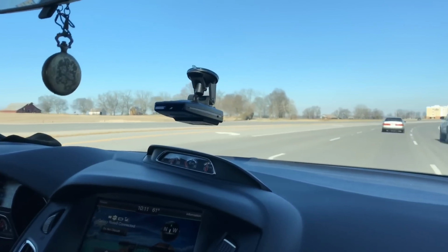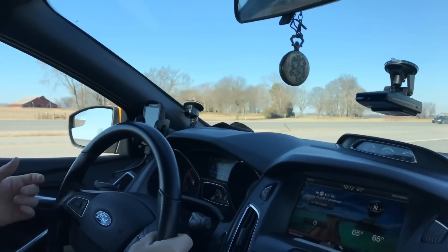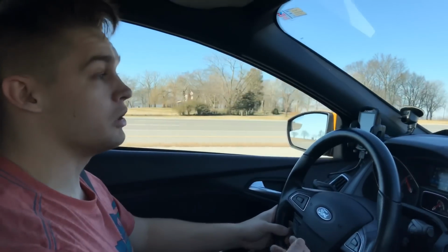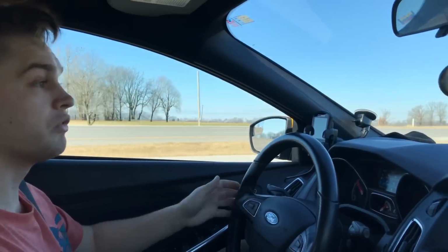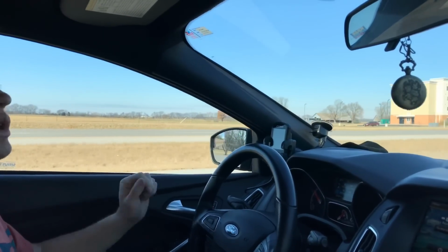My only regret, now that I'm looking to possibly make more power, is not going with a larger turbo. If I was to go back and do it, I'd probably go with a 3071 or a 3076 or even one of Garrett's new turbos. But for anybody who's trying to make anywhere between 350 and 450 wheel horse, I think the 2867R is an excellent choice.